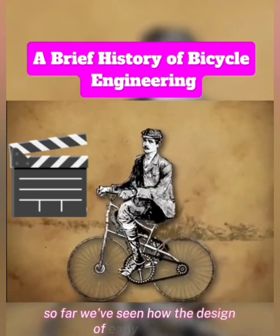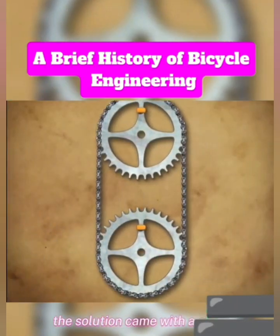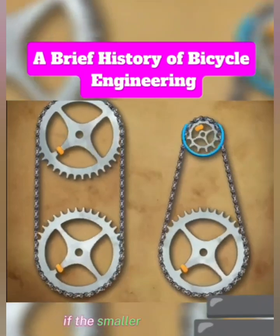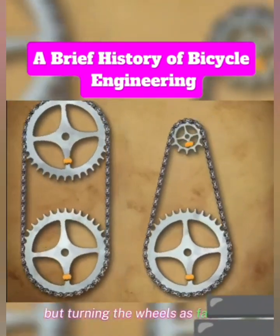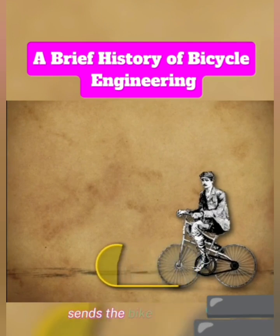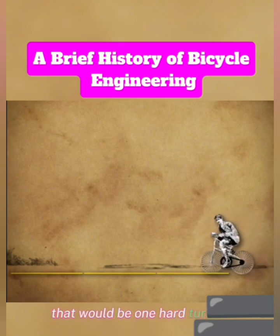The design of early bicycles was focused on getting them to move faster without having to crank the pedals as quickly, and the solution came with a chain driving different-sized sprockets. If one sprocket drives another of the same size, they turn at the same speed. But if a sprocket turns a smaller one, the smaller one will turn faster — for example, if the smaller sprocket has one-third of the circumference, it will rotate three times as fast. However, turning the wheels as fast as possible isn't always the goal. If you aren't already moving quickly, a chain that turns the wheel faster could create overly hard work. Each rotation of the wheels sends the bike forward one circumference, so if one turn of the pedals is geared to send you forward three wheel circumferences and you are starting from a dead stop, that would be one hard turn of the pedals to make.